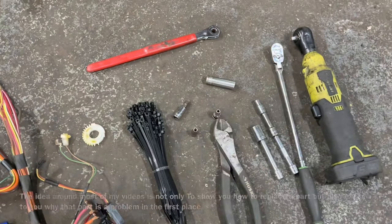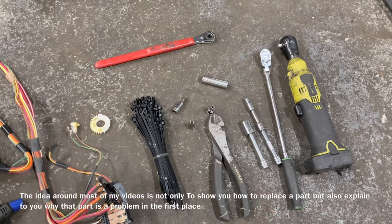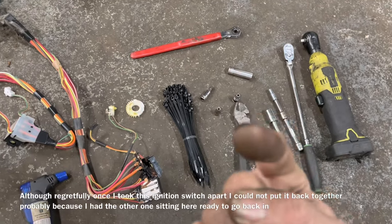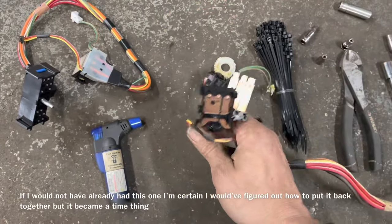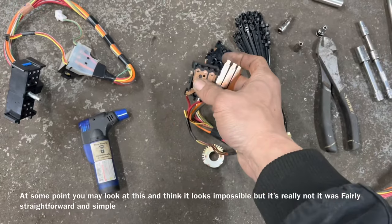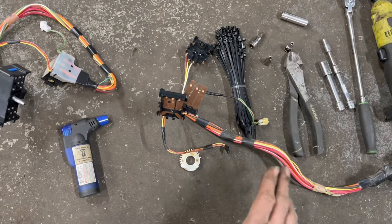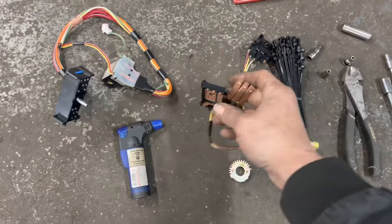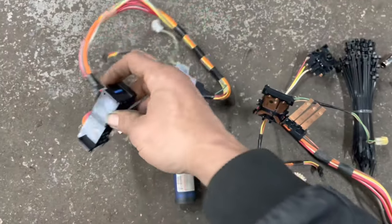We'll take the little hidden screw off and the top cover off. We're going to disconnect the battery even though I don't really think it's necessary — some of you might get scared, and just keep in mind that if anyone else can do it, I promise you you can do it too. I took the old ignition module apart and tried to fix it, because normally there are little copper pathways that this thing works on. The switch wouldn't send power to the car, it broke down on the side of the road — I thought I might be able to repair it because these things are kind of pricey. But that's not going to be repaired. I already had the new part.